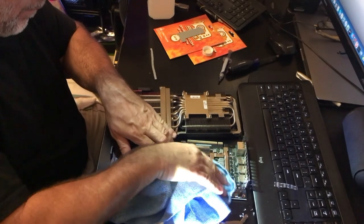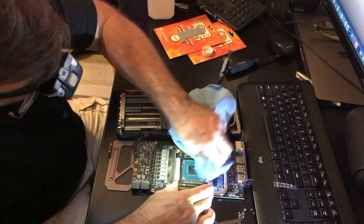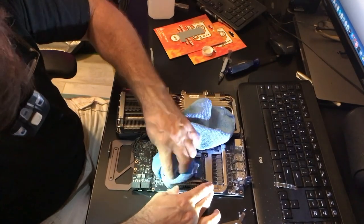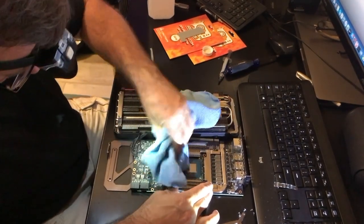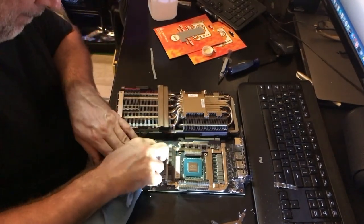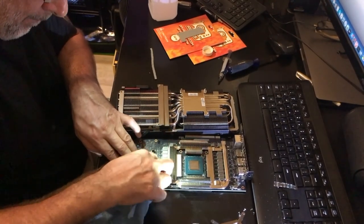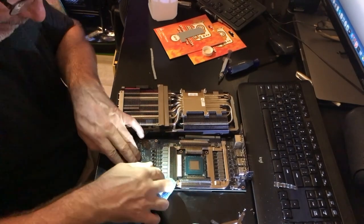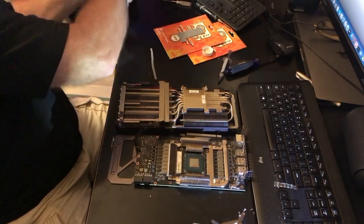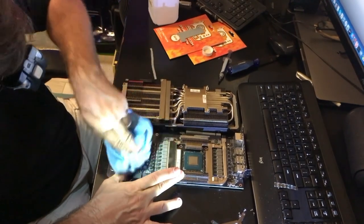The hardest part is knowing which screws to take off on the back when you first do it. You've got the four main larger Phillips screws, then the smaller ones which are the bracket holding the heat sink to the chip, and some surrounding ones. You can tell looking at the GPU from the side where the screws attach by the mounting holes. That's the hardest part - and the nerve-wracking feeling of doing this to a thousand-dollar-plus card makes you a little anxious. Take your time.